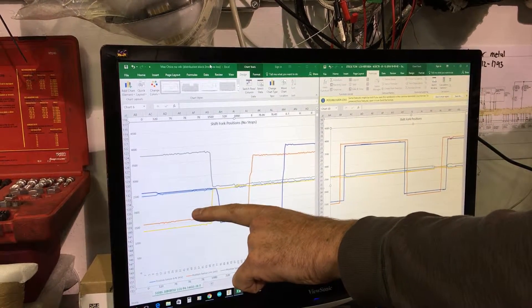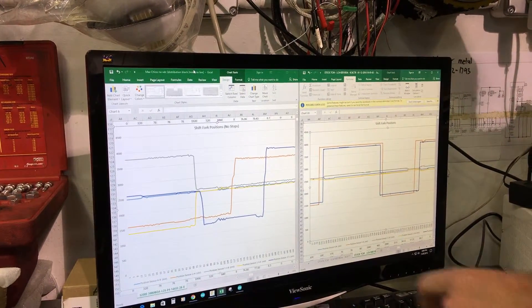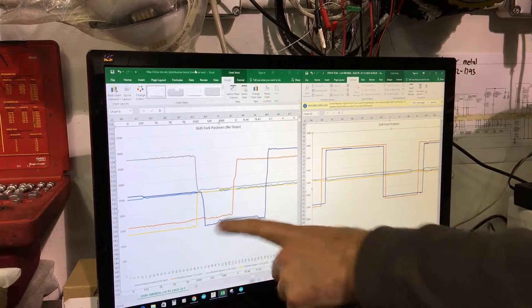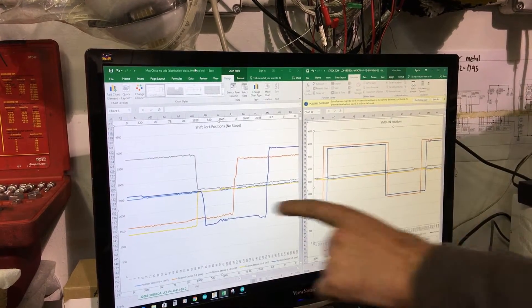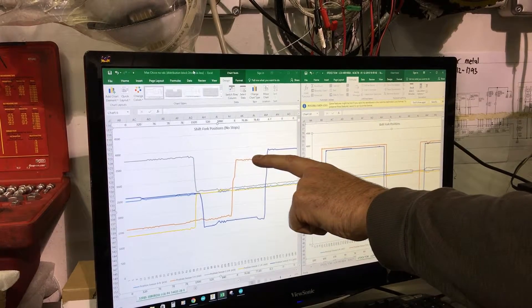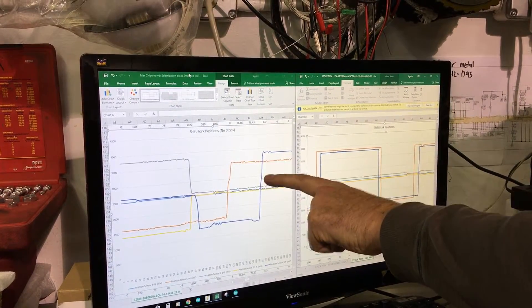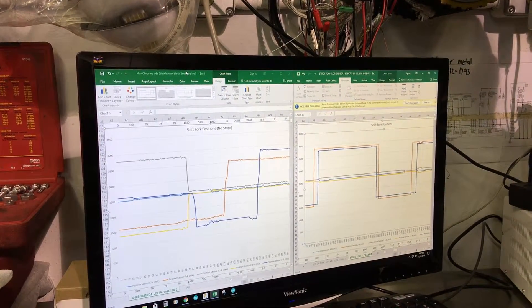If something's stuck in the middle and won't move, you may actually have a CBA with a broken piston stop — that's pretty common. Or if you're doing a pull and it feels like the car's popping out of gear, data log the pull. You'll see a nice line as it's engaged in the gear during the pull, but when it pops out, you'll actually see the shift fork pop out of gear. It's pretty straightforward.